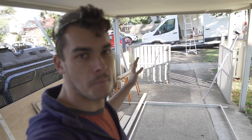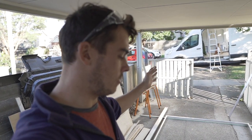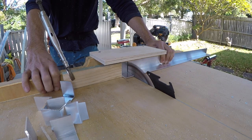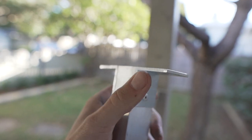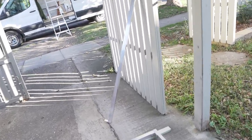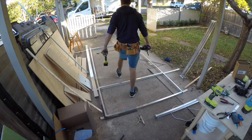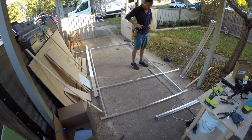So this is how I'm going to build the roof rack — I'm gonna pop rivet it all together. I've made these aluminium brackets that go on either side of the cross members, just pop riveted on, cut on the table saw at 45 degrees. I've got all the cross members ready, and I'm gonna lay it out on the floor here and pop rivet it all together. I think that's gonna work.